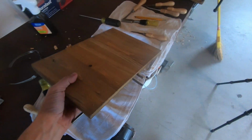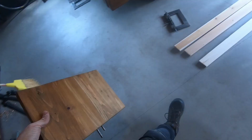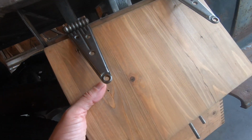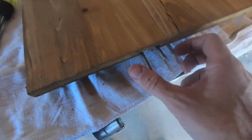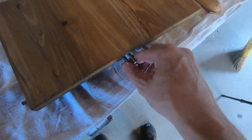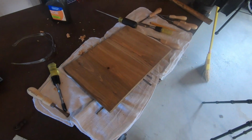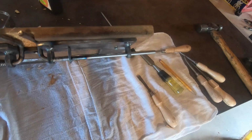It's got a little weight to it now, because that is like 3/16 or 1/4 inch plate on the back. But just to give you a little reference, this is what it's gonna look like from the front. You're just gonna see 2 little tiny tabs hanging out the bottom, and I only want those long enough so that you can get your fingers on it. So maybe 3/8 of an inch down. I want it to look like there's nothing holding the boxes shut. And then obviously I have to drill into the side of the box so that these pins have somewhere to sit. Time to cut some boards and glue some panels together.